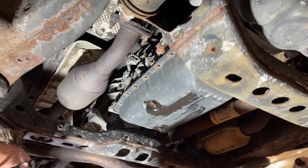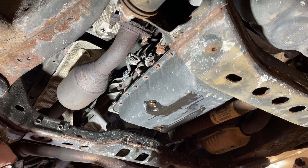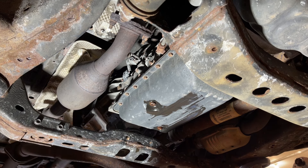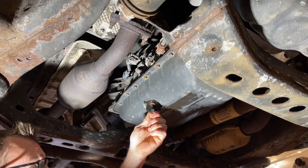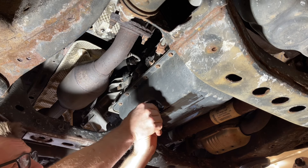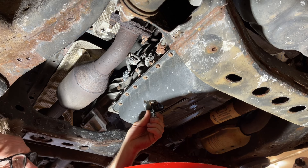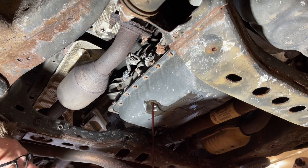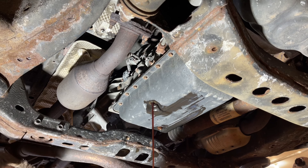Okay we've hit 115 degrees. I like to start when it's at the bottom of the threshold so we'll be done with it before it hits the top. So we're going to pull out the level check plug. It wouldn't surprise me if it dumped out a quart of fluid, but we'll see — that's why we're following the procedure. Okay there it goes, now that's draining.